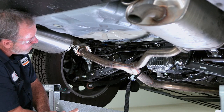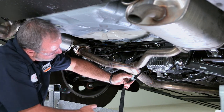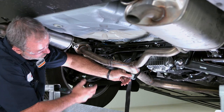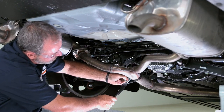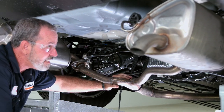Now that we have the five rubber exhaust hangers out of the way, we're going to go ahead and lower the exhaust. I'm just going to loosen up the strap here, support the exhaust with my shoulder a little bit, and we'll just come down with it nice and easy. And that's all we need there.